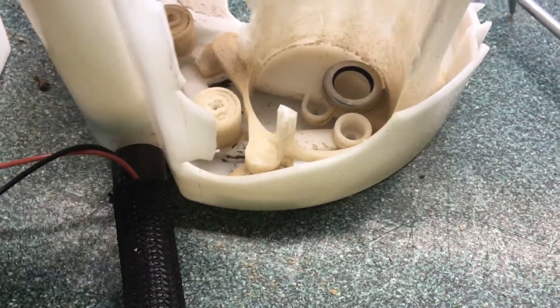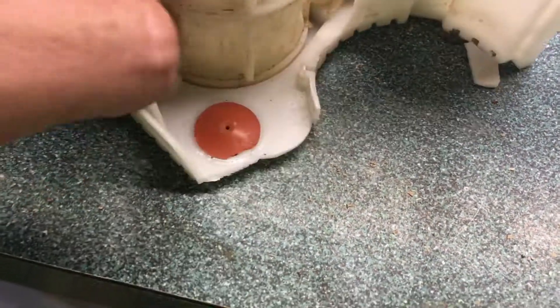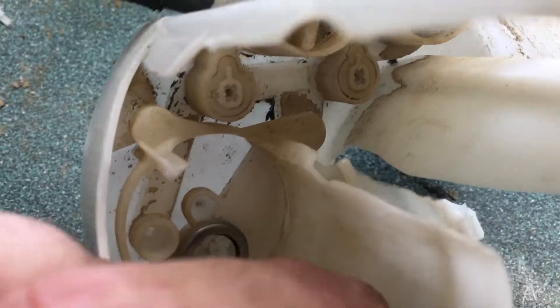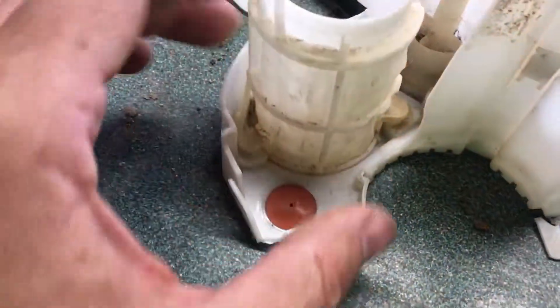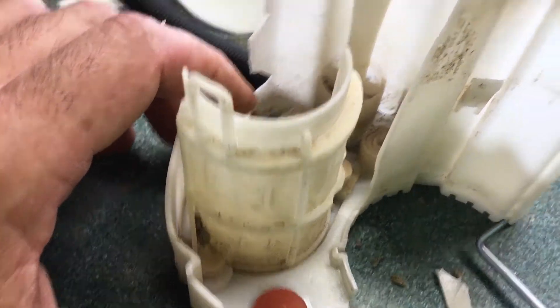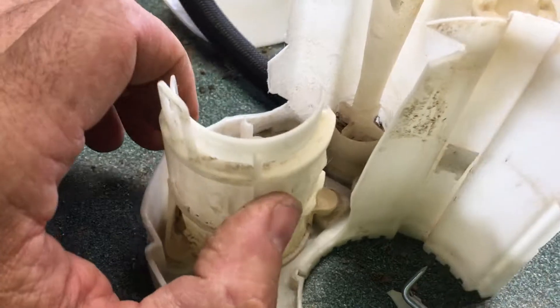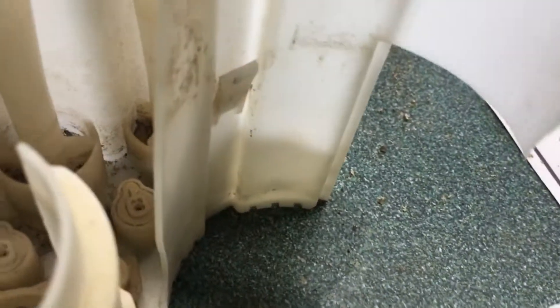With some removal of material I can now see exactly how it works. Here's the intake for the pump — that ring right there. Where is it picking up fuel? It's on a little elevated floor. Pulling back to where the fuel filter sits, this is all very fine screen, and it comes down to that compartment — that's where it gets its fuel. So it has this screened area along the edge inside the cup. That's the fuel sock equivalent — quite the mechanism. It's running at regular pressure, around 45 PSI, but it needs those little venturi pipes to keep fuel in the cup so the pump never runs dry.